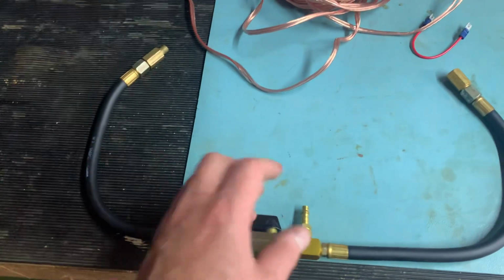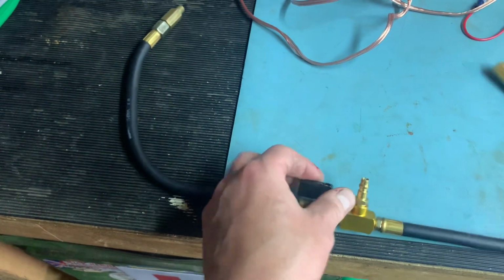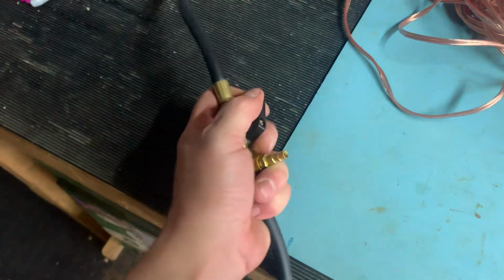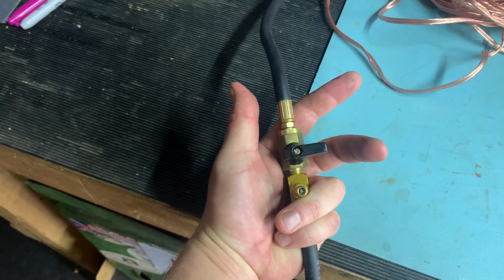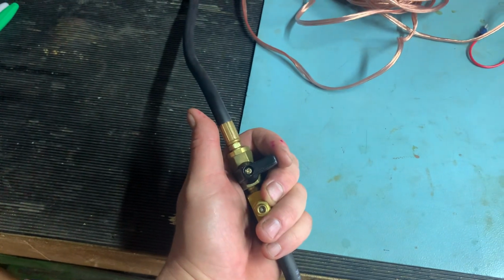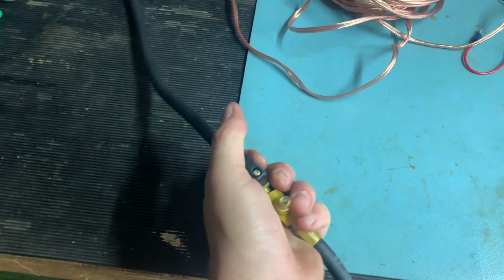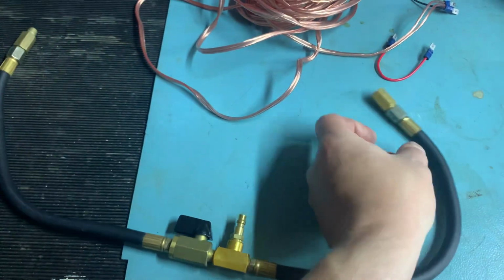So if you want to test the control pressure, you have the valve open in that position. And if you want to test the system pressure, which is basically the pressure that the pump's putting out, I can't close it on my own. Oh, there we are. So if you want to test the system pressure, you have the valve closed, and that then goes to full pressure, and you can see that. On a DeLorean, you're looking for about 70-80 psi. When it's open, that should drop down to 40 odd psi, 3 bar-ish I think it is. I can't remember exactly what the figure is.